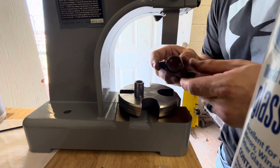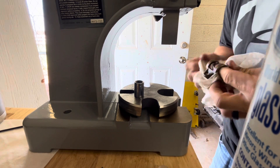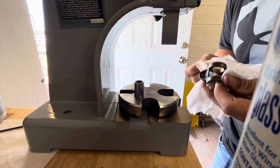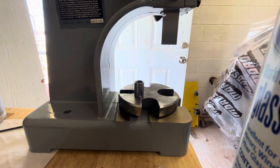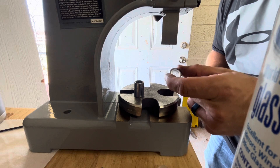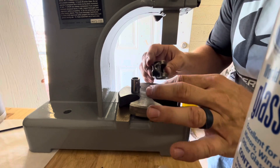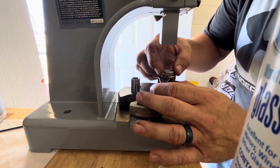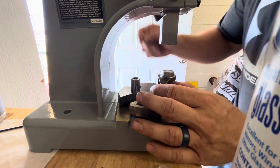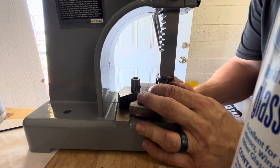Your rocker arm is now completely clean — go ahead and clean out any of the old oil from the surfaces. In a perfect world these would already be clean. Grab your new Michigan Motorsports bearing — it has a plastic cap holding the bearings in. Turn your plate, set down your rocker arm, make sure you get the bearing pretty straight, get it started, and then press it in until it bottoms out.